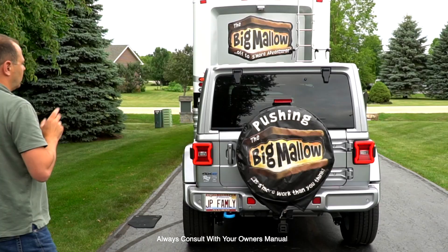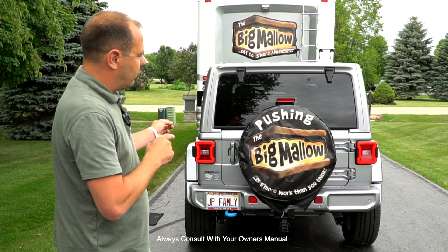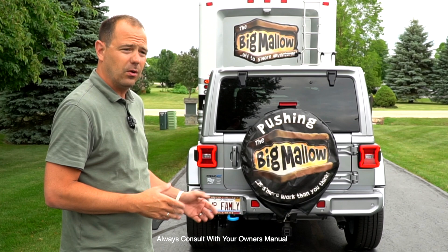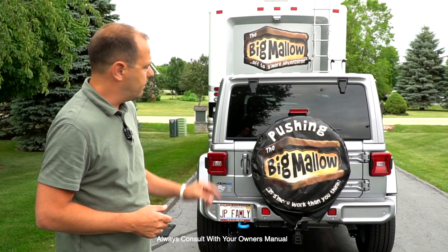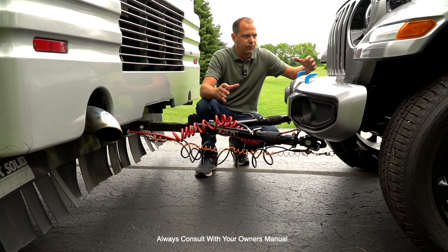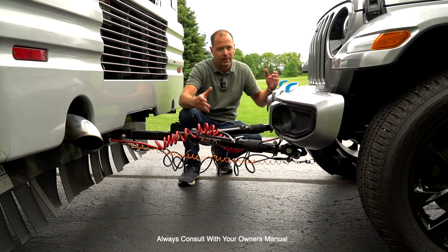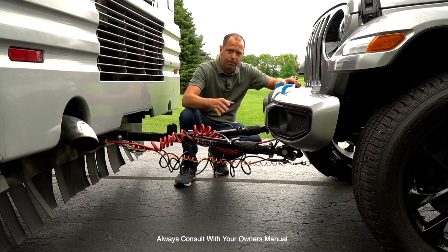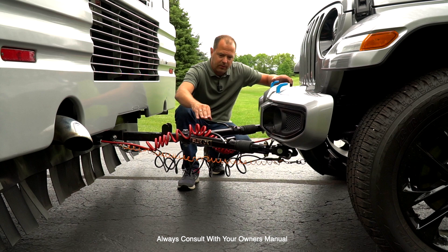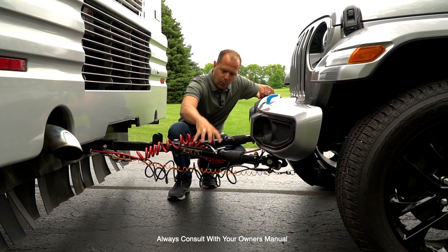I'll always have my wife or someone outside the vehicle as I roll for the first 10 or 15 feet. Right now you can see these bars are compressed — I'm on a slight hill, so when I put the Jeep in neutral it rolled forward into the Blue Ox and was caught. As I pull away these are going to stretch out. You can also put the Jeep in reverse after connecting to back it out until you hear the bars click and lock into their tow position. If one side has more tension than the other, it may take a turn of the RV before the other one locks.